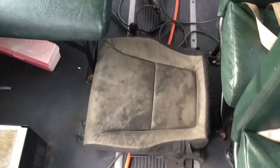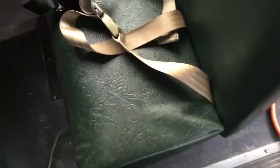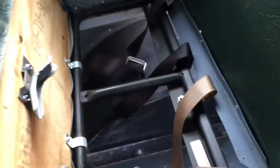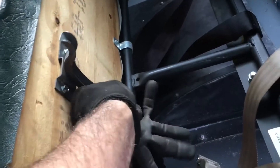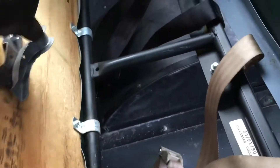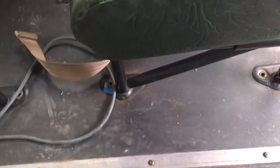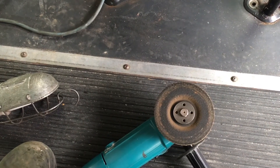Ripping out bus seats — you think it'd be really easy, they just all unbolt. Not if you live in the northeast and everything is rusted. Here's a little trick I had to find out: how do you get to the bolts that are underneath the seat? The seat flips up. There's a little latch on these things. Looking underneath it I thought it was going to be impossible to get those bolts out — just flip the seat forward. We've got a couple stragglers here and there, and I have to get the angle grinder to cut them out.